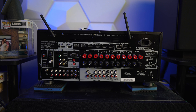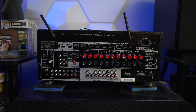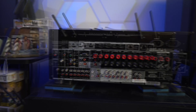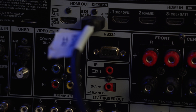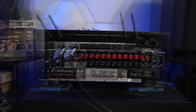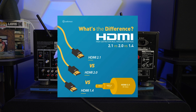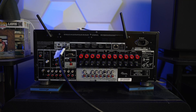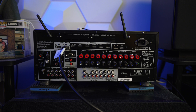In order to hook up your receiver directly to your TV, you need to plug an HDMI cable from the eARC port on the receiver into the eARC port on your TV. On the RZ50, the HDMI out and eARC port is in the left corner. This eARC port feeds all the information from your TV to your receiver so you can pass through audio and video. An important note: HDMI 2.1 is the current standard. If you see a receiver with HDMI 2.0 or 1.4, or one that does not have an ARC or eARC port, you're going to run into issues with current model TVs. If you have an older TV without eARC, you'll likely have to hook up via optical cable and won't be able to get all audio formats. Make sure you do your due diligence beforehand and learn what you have.